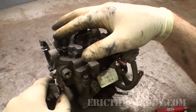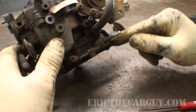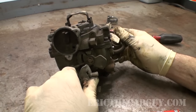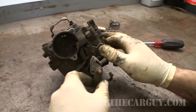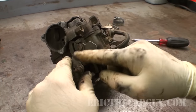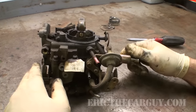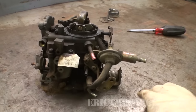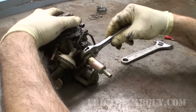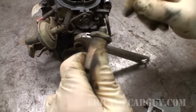Three main parts: we've got our top cover, our main body, and the throttle assembly down at the bottom. Sometimes screws go all the way down through and hold the entire assembly together, so you'll often find different length screws. Watch out for residual gas. Sometimes there's throttle linkage connected to the upper levels. I'm also going to remove this fuel filter that I'm going to replace anyway — it all comes out as one piece and it's bent, which might explain why it's leaking.